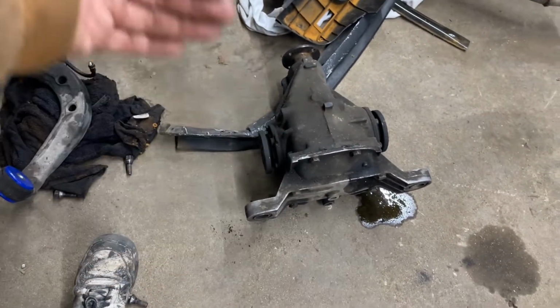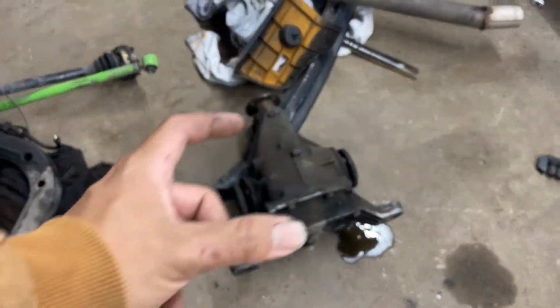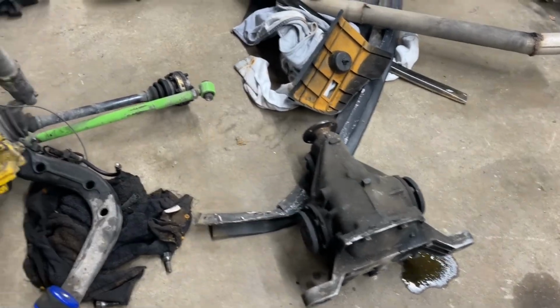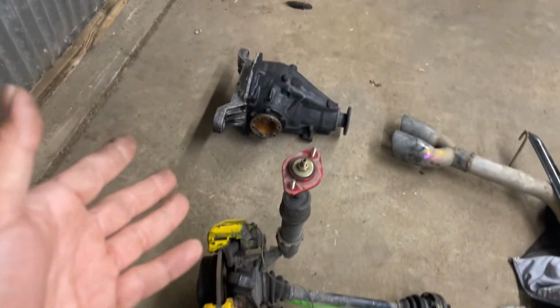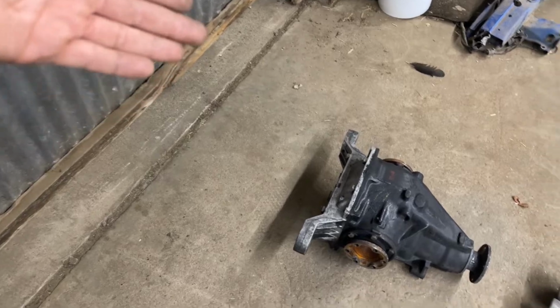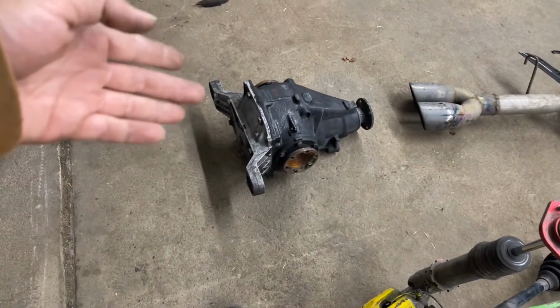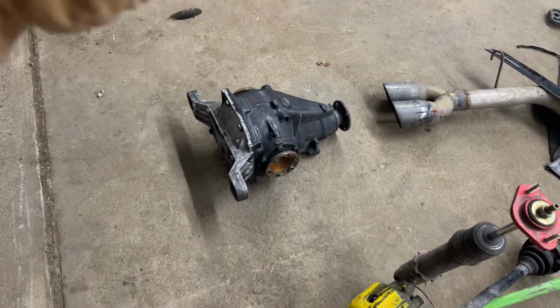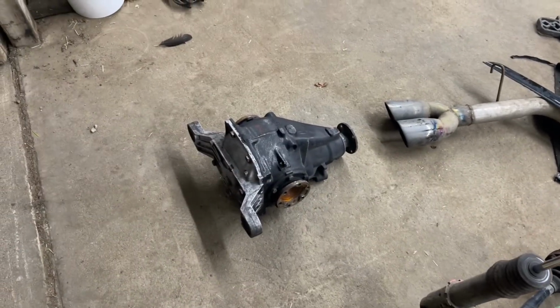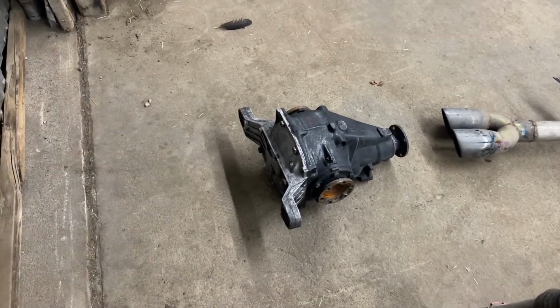So this is the old one where you saw how they drilled a hole in the front, pretty much ruined the bolt, the mounting setup for the front diff bushing. And here's the new one where it is an unabused open diff with 3.91 gears. I definitely had to remove the cap and weld it myself, but I'd rather weld it myself than buy someone else's welded diff. And I feel more secure welding it myself because I've had the experience.